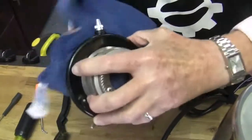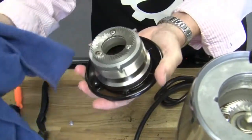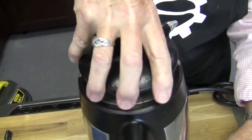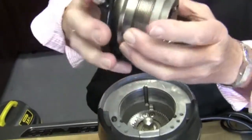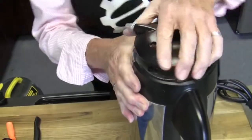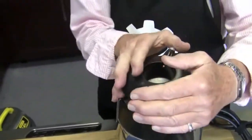So now we've got this all wiped out with our microfiber cloth. Don't forget — this is a reverse thread. It's got little grooves that you have to start it at. Make sure you're lined up, then put it back down and turn it until the two burrs are meeting. Back it off a little bit and put that screw back in.